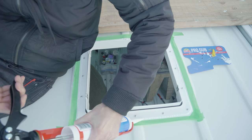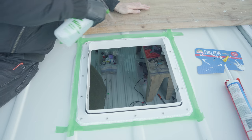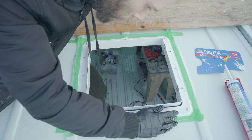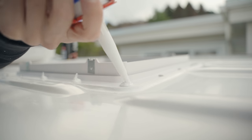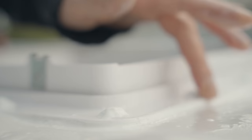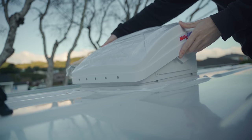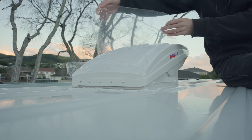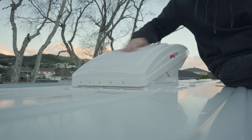The edge of the collar gets a full perimeter of sealant — I'd really rather water not get in there. A little trick from a plumber friend: if you spray sealant with soapy water and spray your finger too, it doesn't stick and you get nice clean edges. With the sun getting low, all that's left is to attach the actual fan unit to the collar with a couple of screws and remove the plastic. Can't test it yet until I've done the power system, so let's move on.